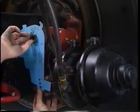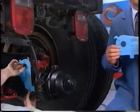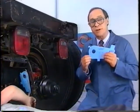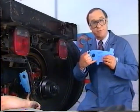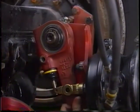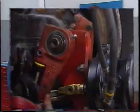Clearance templates are available to determine if a Rockwell automatic slack adjuster will fit your application and whether you need a pawl on the side or on the front. Follow the directions printed on the template, but remember, the adjusted stroke will be shorter than the figure on the chart. If you don't have a template, check clearance by rotating the new slack adjuster by hand during installation to ensure unobstructed travel for the entire push rod stroke.